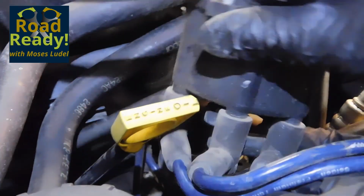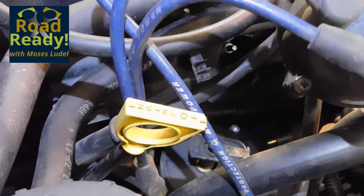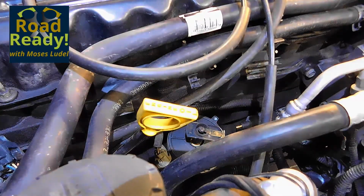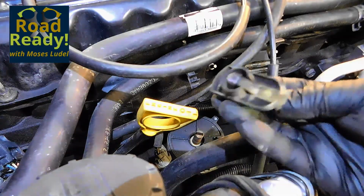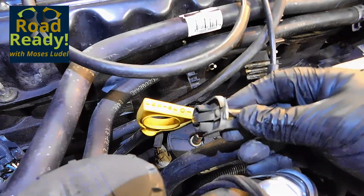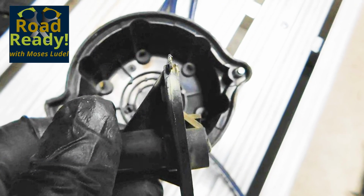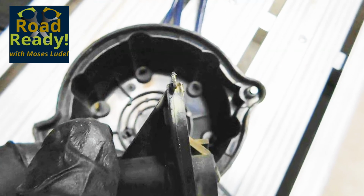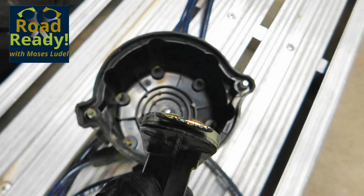Lifting the distributor cap out of position exposes the rotor and the distributor. Inline four-cylinder and six-cylinder engines are much easier to service. This Jeep engine in particular is a traditional and easy-to-tune engine. This is a good ground school for those first wanting to try their hand at ignition tune-up. This ignition rotor is extremely worn. It has been exposed to so much heat and firing voltage that it literally is melting on its tip. The distributor cap and rotor really needed replacement.